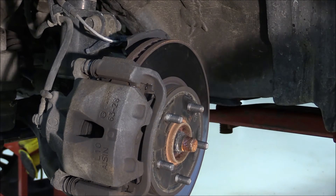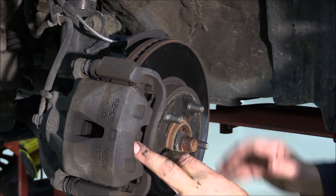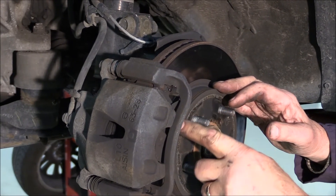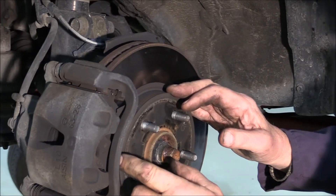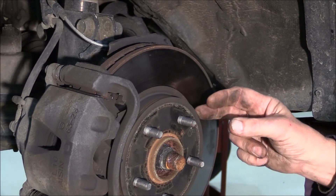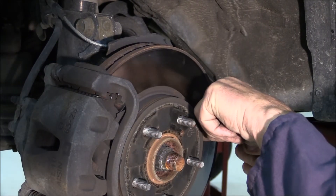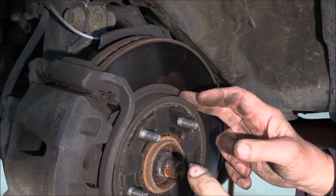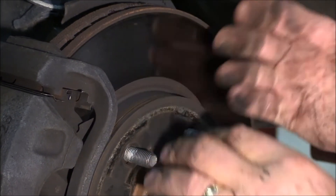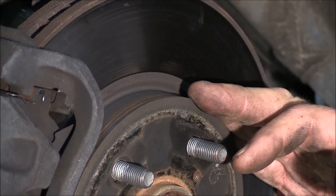The other thing I want to point out is that on this particular vehicle, the shim has migrated off the brake pad — you can see it right here. This shim has contacted the rotor hat and is starting to cut a groove in the rotor hat. If this would have continued, eventually this shim would have cut that rotor in half, and the braking surface would have come disengaged from the rotor hat, and you would have lost braking on this side.